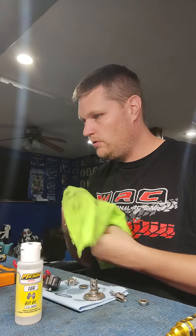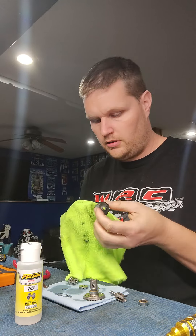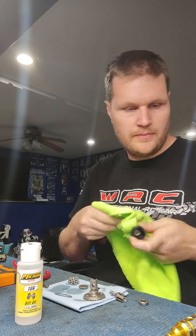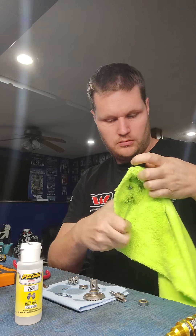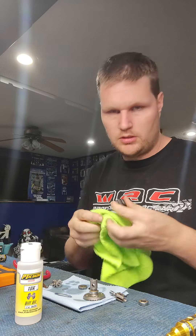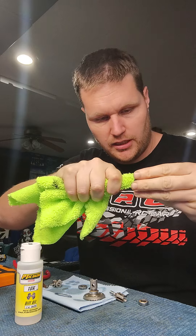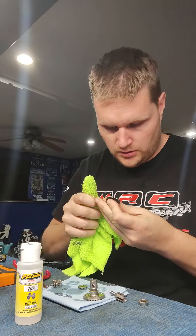I've pulled the o-ring and out drive out of the cup. Now I put a little Simple Green on my rag and clean where the bearing goes — that little surface where the gasket goes. Then I get a nut driver on my rag and clean where the out drive goes in there. I also clean the groove where the o-ring sits by wrapping my towel around a 5.5 nut driver, sticking it down into that groove, and twisting to get it nice and clean.